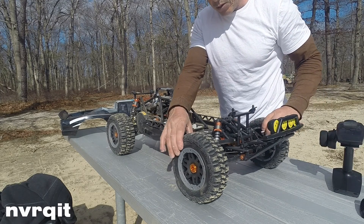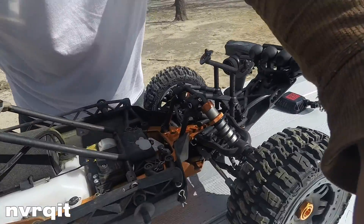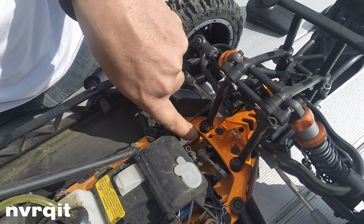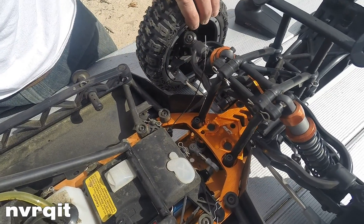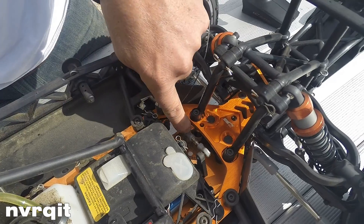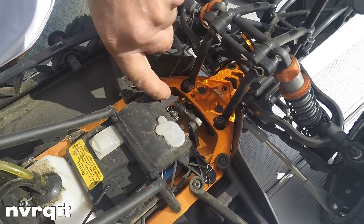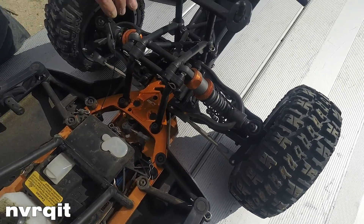The steering arm — I'm going to show you right here where this bolt is. It was a little too long and it would stick down about 2 threads. When the suspension turns and the arm goes this way, you can see it was touching underneath it, so one full steer to one side was limited. I fixed that up.